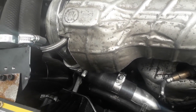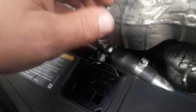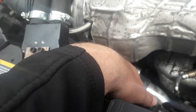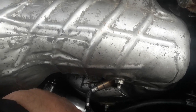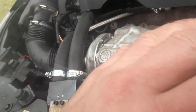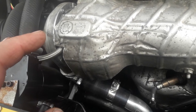So to summarise: take your standard turbo off, bolt on the new replacement exactly as normal, fit the oil feed pipe — this turbo bolts straight onto the standard oil drain. Fit the silicon pipe and the metal joiner which goes down into the standard intercooler pipe, put all your covers on, change the DPF or leave it — your choice. Then at some point get your remap and enjoy the power.